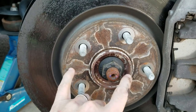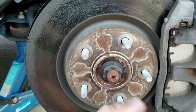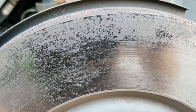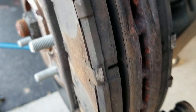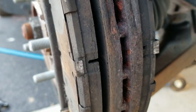There are some cars that have screws that hold the rotor on, maybe here and here. This car doesn't, so that makes it much easier. Let me know what your thoughts are, especially if you're a mechanic — would you resurface these or just dump them? My brake pads on both sides have plenty of meat left on them. As I was saying, the rotor is in really bad shape, so I'm going to pull out the pads and make sure they're not glazed or anything.